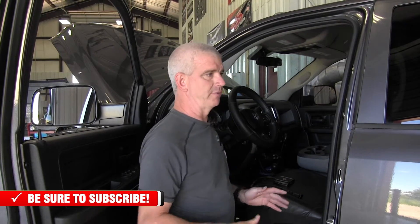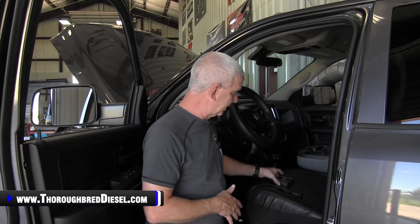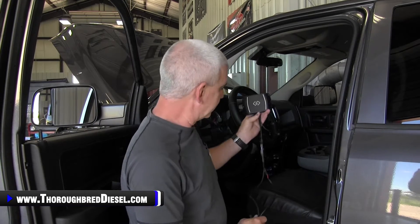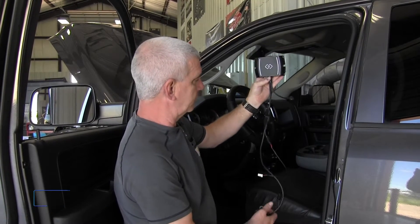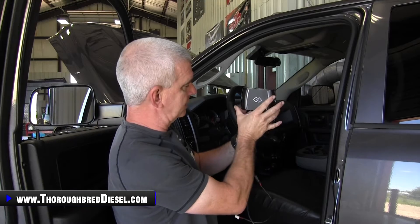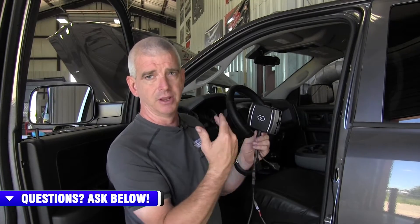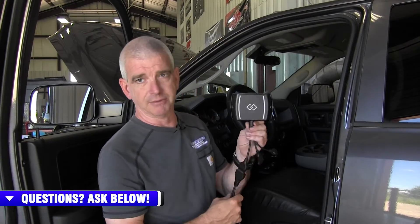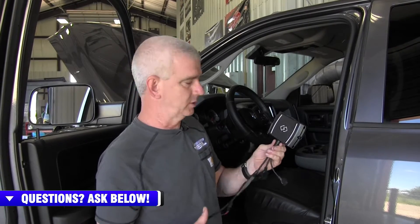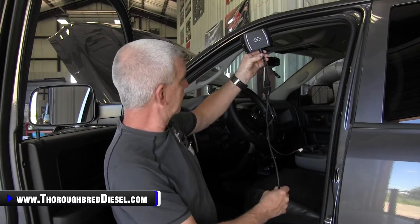We're just going to unhook our normal OBD2 drop that comes with the device, and then our unlock cable will plug in right there — get it lined up and it snaps. This drop here is what goes to our CAN-C star connector. Now, this is only for the 2018 OBD2. Any other platforms in light duty diesel, you're only going to be working with your normal OBD2 drop to your EZ-Link module. One thing to note: these wires don't have to go out underneath the hood — we are fully contained inside the cab. There are several holes on either side of the EZ-Link for mounting under the dash, and you want to keep it away from pedals and clutch pedals so you're not making contact with the box.